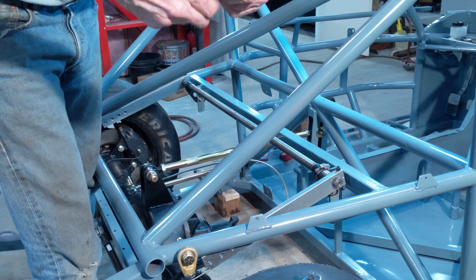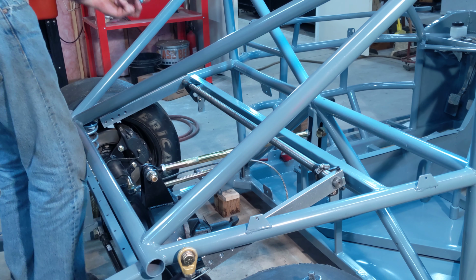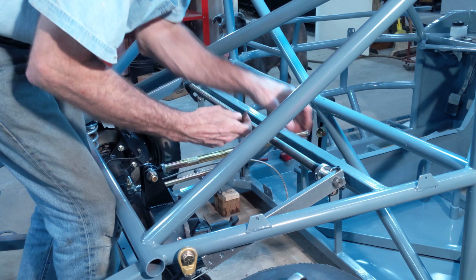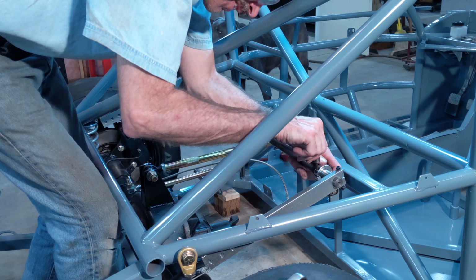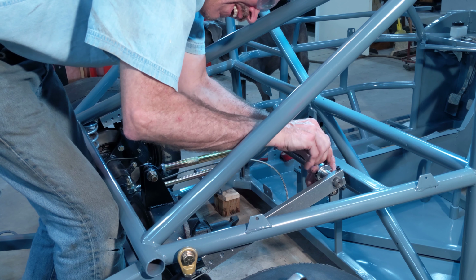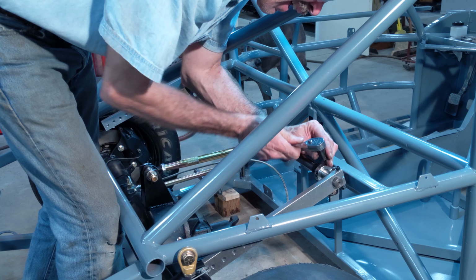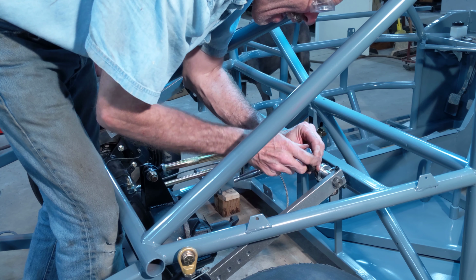So I just take the bolts out of these puppies, and they're split. Now when you put these split collars on, you don't want to jam them too tight against the brackets. Leave a little bit of slop just so things can move around, about a 1/16 of an inch total. And these are just aluminum, so don't crank them down so tight that you split them. Just firm.